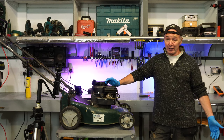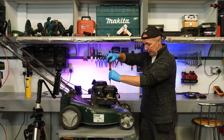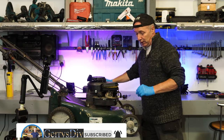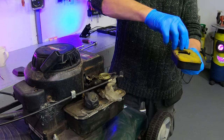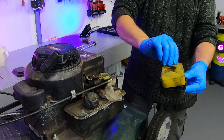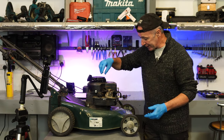To get this carburettor off we need very little in the way of tools. Let's start with a flathead screwdriver — a fairly chunky one. We're just going to take this off. This is the air filter. We've got a long bolt — leave that there. We've got a cover. The whole thing comes up, and just to show you the bits, we've got a fairly grimy sponge. It's original as well — it says Briggs & Stratton on it.